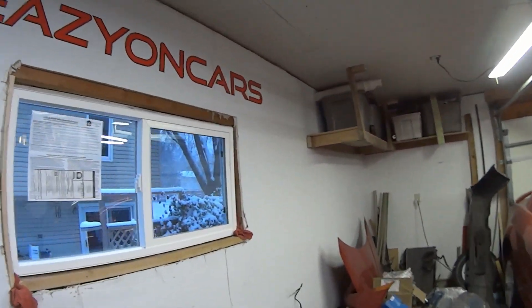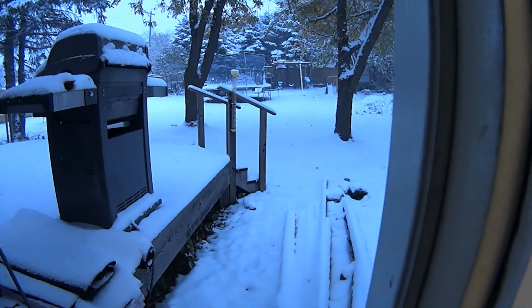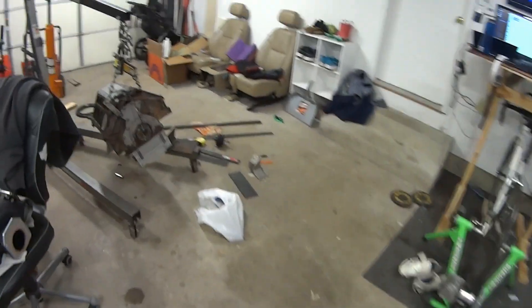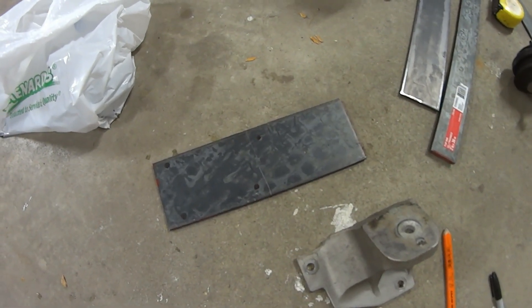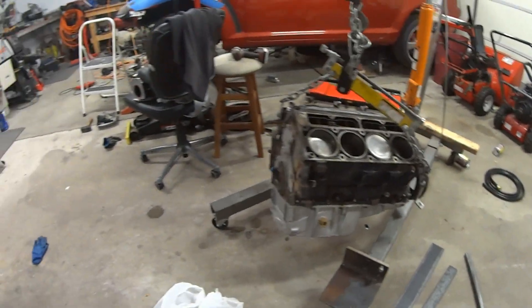We are making the engine mount brackets and it is snowing outside — unprecedented for mid-October, but it is what it is. I have this quarter-inch steel plate and I've put a pattern for each side on it. You should be able to make those plates pretty easily — drill the holes and get both mounted to the side of the engine. We'll put the engine back in the car and see exactly how tall they need to be, mock it up a few different times just to make sure, and eventually put the transmission in the car to confirm everything fits.